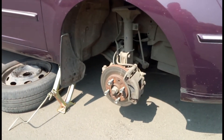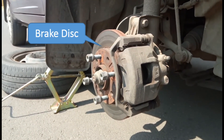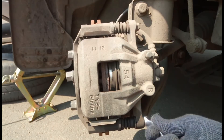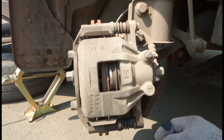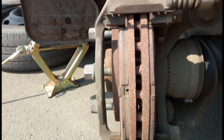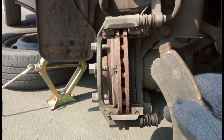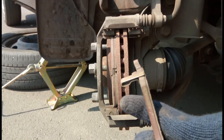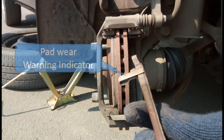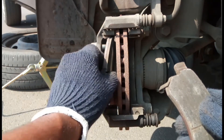First we have to remove the wheels, which I have already removed and kept ready for inspection. Now you can see the car's disc brakes, which usually contain a brake disc and a brake caliper. Loosen and take out the caliper lower bolt and slide the caliper housing upward. Now you can see a pair of brake pads — pull out the inner one and you can see a metal clip on it.